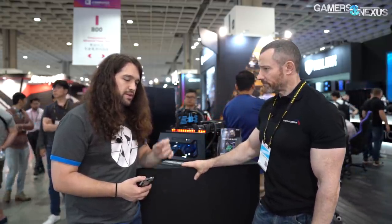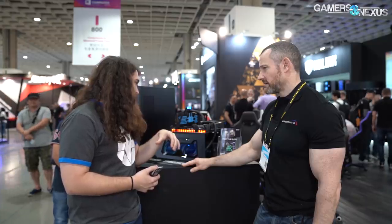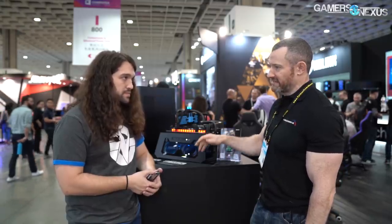So one of the focuses is that there are different hotspots on the dies — it depends on every type of die or at least every family. That's a nightmare to design for. We did some x-rays to find out where the heat's coming from on the die itself. Then we tested many, many impingement plates for each block to get direct flow over the dies — essentially the hotspots. Any Skylake-X die is the same for 12-core, 18-core, whatever; they just cut off features on the CPU itself. So we've optimized the impingement plate for the die in question.